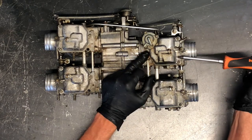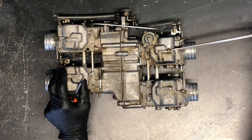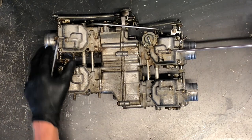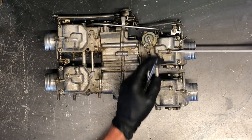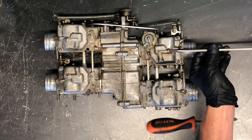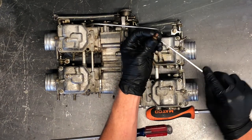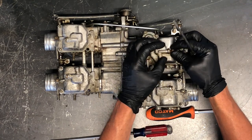To take the bottom bowl off, there are three Phillips screws and this entire bowl will come off. To drain your fuel for the season or after it's been sitting all winter, you can loosen the banjo bolt here — just a couple turns and the fuel will start to dump out. This is a banjo bolt, meaning it has a line running through it, with a small port that dumps out the bottom.